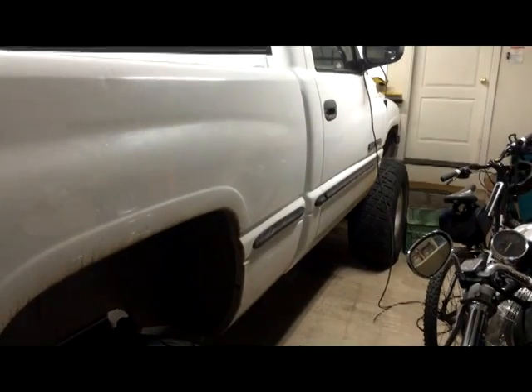We came to the rear exhaust area, and you can actually feel it — feel the cooler air coming out of there. So the exhaust valve has a problem. It's closed all the way but it's probably burnt, and it does move freely up and down, so that's probably the problem. We'll pull the heads off and have them redone, and we should have a running truck. That's how you do a cylinder leak test.